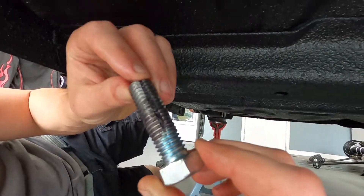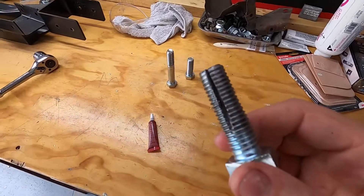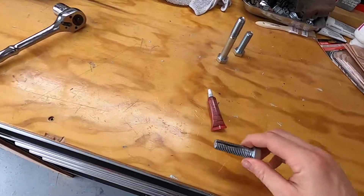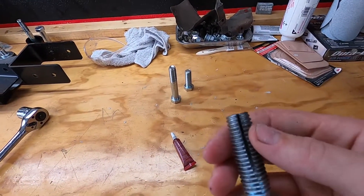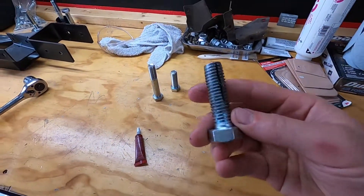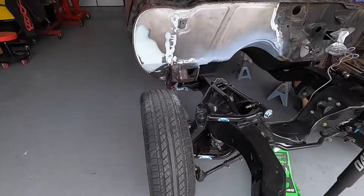It's got some metal on it so it was cutting. The hole still looks fine. It worked - we cut little slots in our bolt from Home Depot, and we kind of filed down the threads just a hair so they're less sharp, so it goes in there smoothly. We went ahead and tapped it two times, cleaned it out, and it seems to be good. It's still a little tight, but I don't think we're ever going to get it to where it's not tight. So we're going to go ahead and put the subframe up.